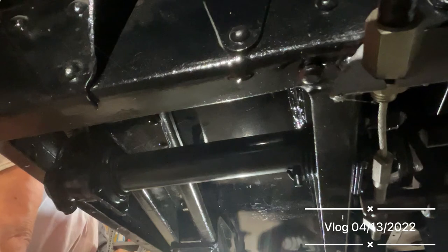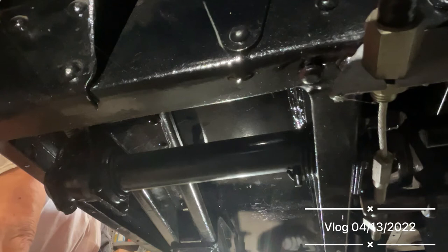Today I want to do a bit of a say on the braking system for the Austin 7, which is a constant problem for most people. The cross shaft, which you can see in this picture, is normally on the early cars a single tube which runs from side to side of the car. The problem is that when you put your foot on the foot brake, it exerts so much pressure that it twists the bar by about 15 or 20 degrees, so there's absolutely no way you can get both back brakes to work together.